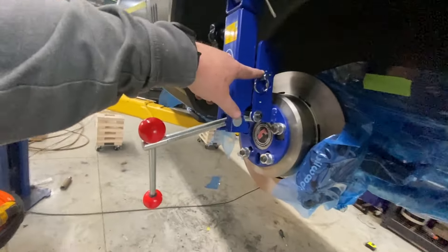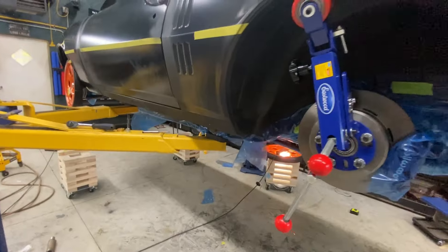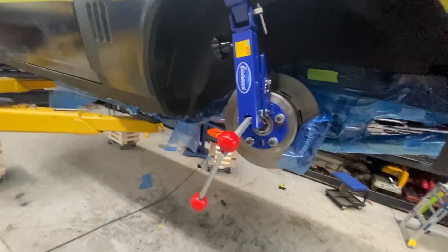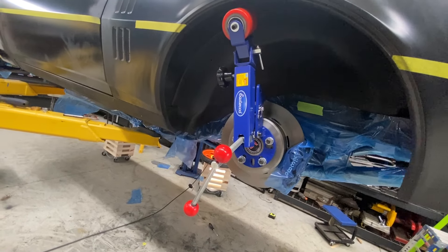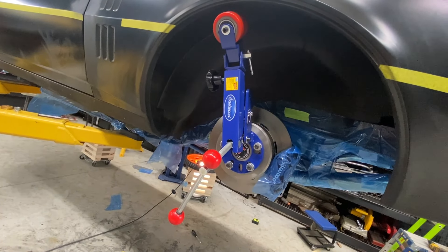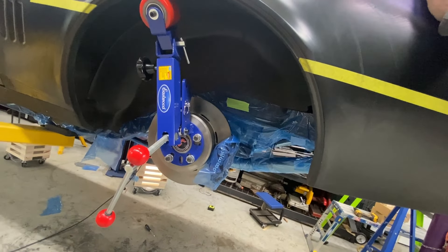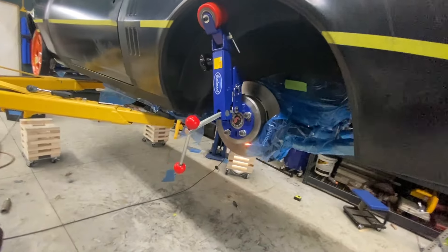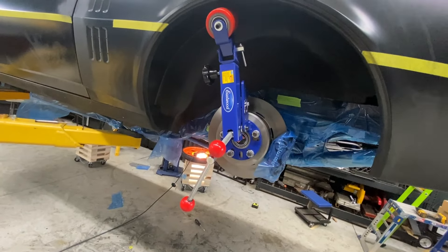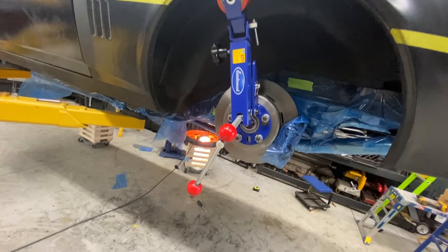The other thing I had to do is redrill some of the holes because the way the holes were, it was for a much bigger or smaller fender well — didn't really like this size. So I had to redrill one hole for the pin, but not a big deal. It's just not a good tool for doing this unless your fender is a perfect arch, your quarter panel is a perfect arch, and it is lined up perfectly with your axle. I'm lined up pretty well with the axle, but it's not a perfect arch — it just isn't. And of course it kind of fluctuates in and out too, so it's obviously much wider at the top than at the bottom. So I'm going to suspend using this for right now and go back to just working the edge with the hammer and dolly, trying to get as much as I think I might need.